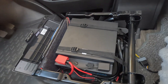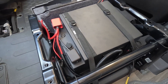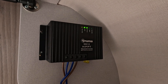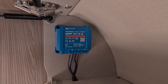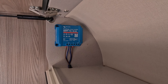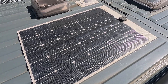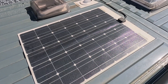For good measure we've been able to retain the original securing straps. Last but not least, it's out with the old Truma MPPT solar controller and in with the new Victron MPPT Smart Controller. This new 15-amp controller will accept an input of 220 watts of solar — we currently have a single 100-watt panel, so we now have the possibility to add a further solar panel at a later date if we wish.